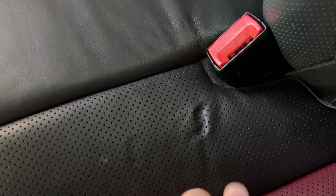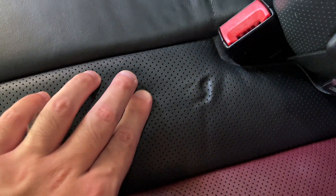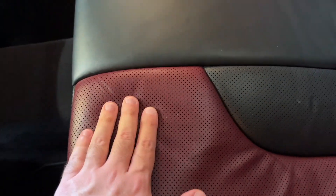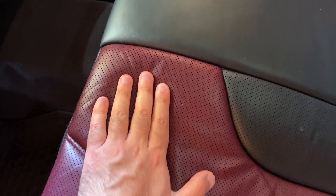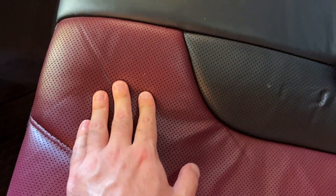It is now the next day — the leather has had ample time to dry and it's nice and matte. The smooth non-perforated sections feel like brand new leather. The dimple has gotten a lot better, and the marks from the child seat have improved greatly. I think because leather will shrink with heat, applying a heat gun on a low setting with Rejuvenator Oil on it could help further. The red color is excellent — it didn't discolor it at all. The springiness is worth explaining: when leather gets old and hard, it's more likely to crease, and creases cause cracking, which eventually causes ripping. Now it's more springy and the pressure is distributed more evenly across the leather surface. The second application was definitely worth it.